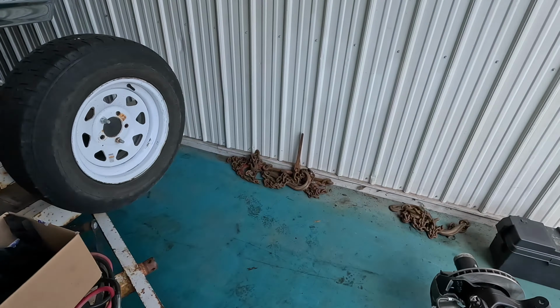So the other thing I need to get off, this power steering box leaks around the bottom seal. I'm sure you can get a seal and whatnot, but there's plenty of play in it anyway. I don't really see it worth putting any money into. And then this is the 77 style pitman arm, which is a serviceable part if you can find it, because it's got the ball joint in it. The one that's on the other box is just straight and it has the hole for the ball joint to be on the drag link. So I'll work on getting that off as well.